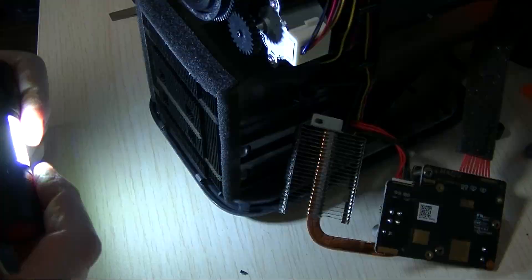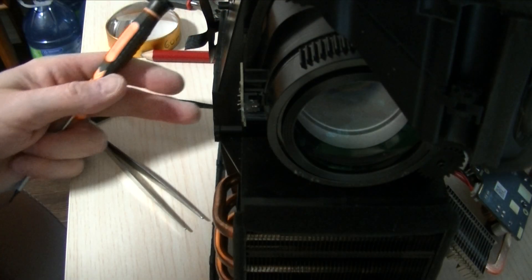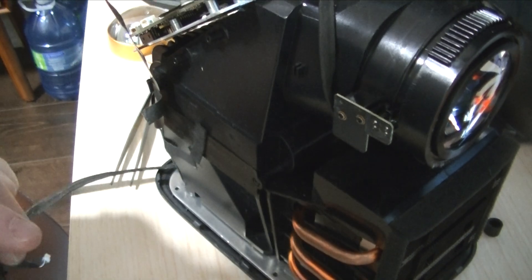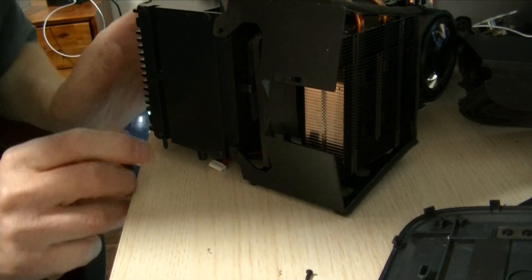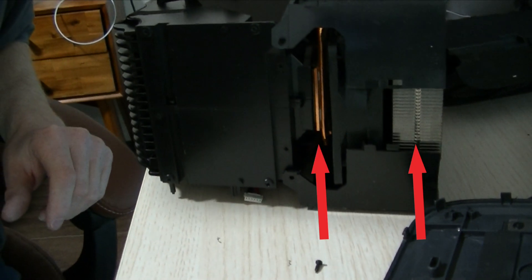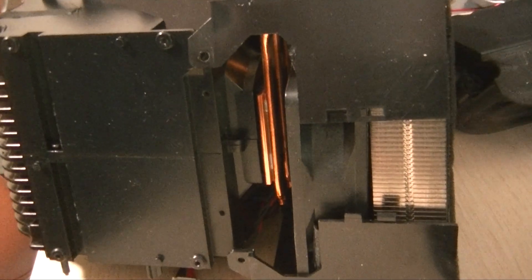We are still trying to get to the optical system and there is no easy access. I've had to remove two screws that hold on the power supply board and one screw that holds on its heat sink. The plastic body enclosing the optical system seems to be made in two case halves that are screwed together in multiple places, and to get where I want to go they have to be separated. That means I'm going to have to take off the heat sink for the mirror and the bottom plate as well — I'll have to strip down almost everything. I was able to separate the plastic halves underneath the fan and the heat sink. What I can see is that the fan is sandwiched between the heat sink and the light emitter, and the heat sink and light emitter are inextricably connected together as a unit by the heat pipes. This is all that can be seen of the light emitter so far.